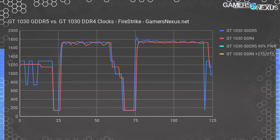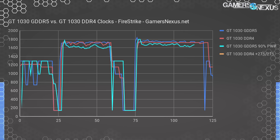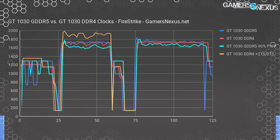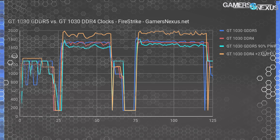A 30 MHz difference will never amount to a 50 percent change in performance. We did another test pass with the EVGA GT1030 GDDR5 card's core throttled with a 90 percent power limit — it regularly dips below the DDR4 card's core clock, but as you'll see it still outperforms significantly on score. Finally, we show the overclocked GT1030 DDR4's core clock offset by 275 MHz, peaking at 2000 MHz — an impressive gain of nearly 300 MHz — yet performance is still behind the GDDR5 card, and the core can't make up for the choke created by memory bandwidth, particularly on texture filtering.